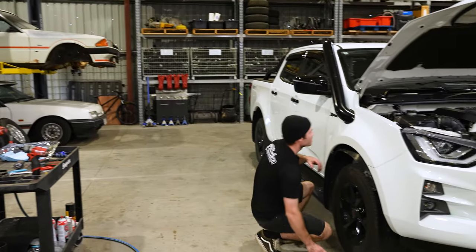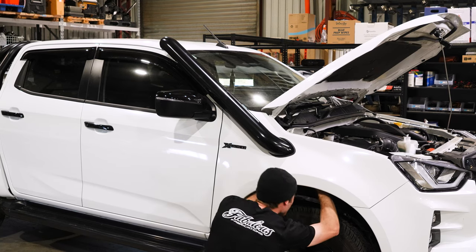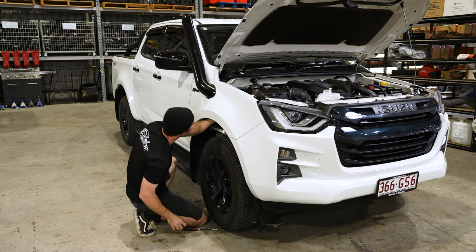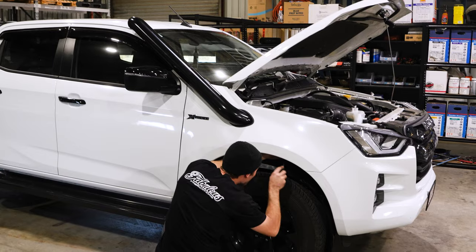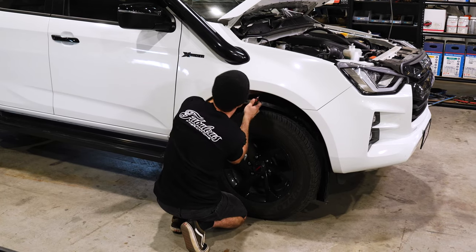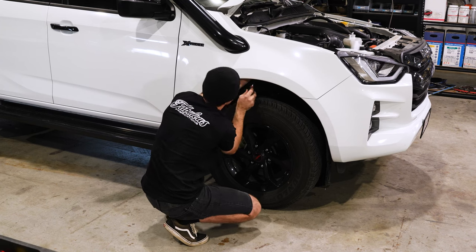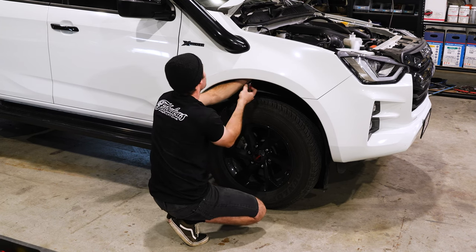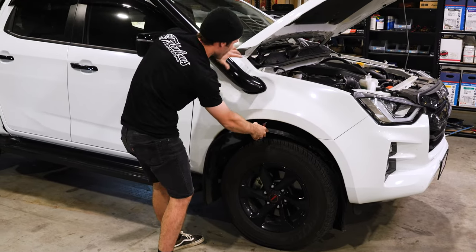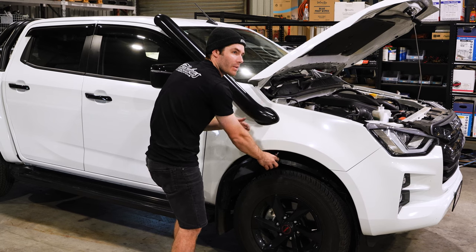Once the pillar screws are tight, you can then move on to your final positioning. So I'll slide the hose clamp up to where it needs to go. Make sure the snorkel's into the silicone far enough. Tighten up the hose clamps. So before I fully tighten this hose clamp, with all of our snorkels, we tend to roll them down and put a downwards pressure on them just to help them sit in the cutout and flow with the car the way we want them to.